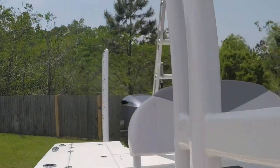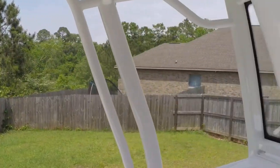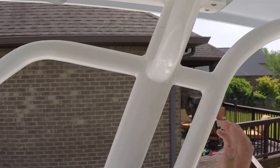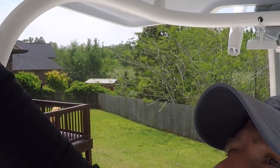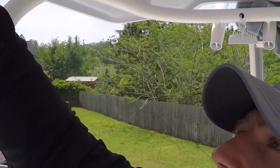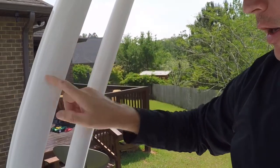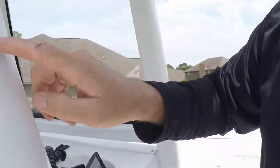In order for me to get the wire in, I tried several methods. Tried to use the vacuum cleaner. That didn't really work for me. But what I ended up doing was I got a piece of fishing line with a small weight on it, like 50-pound test, a braid, and I just dropped it all the way down, and I just kind of worked its way by jiggling it, and it worked its way all the way down. And the weight will go all the way down to here and it'll just kind of stop.